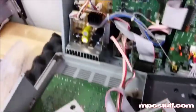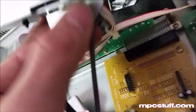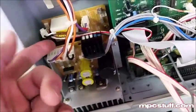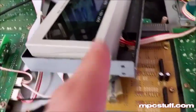Now I'm going to show you how to wrap the cable to the controller. We have our LCD housing back together and put it back on, and I've fished the black wire out through the bottom. A lot of people just end up cutting the old wire off here so you don't have to undo everything, then just tape off the ends. Over here you can do the same thing — just cut it off since it won't be used on either side. It's not a big deal to leave it in since it's secure and nothing's going through it. Now we'll be using the black wire instead. I'm going to do the side pieces here and put this back in for the tilt and then show you the next step.